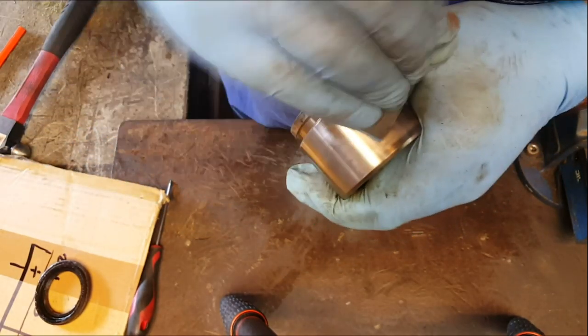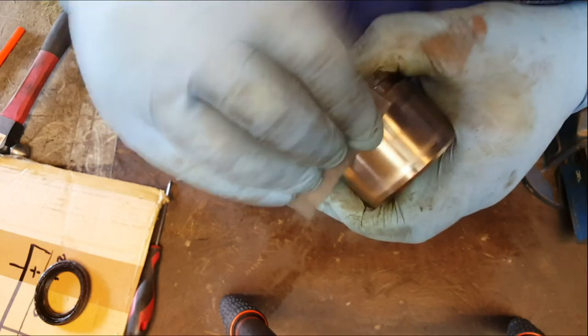And if there's any kind of pitting, we'll be able to see it really easily after we've done this. Then we can decide whether the pitting's insignificant and we can just continue to use the piston, or whether it needs to be replaced. Now, these brakes have overheated considerably in the past. They've been binding. So I will do a measurement check as well after we've done this.